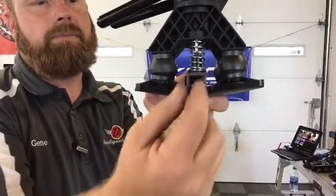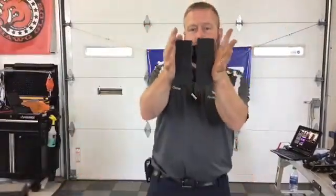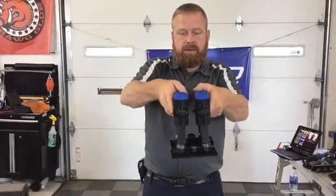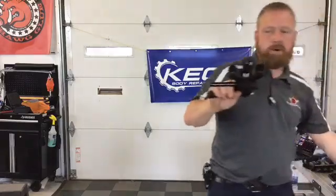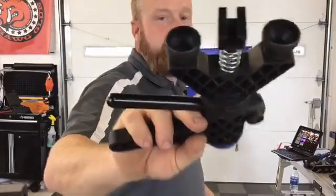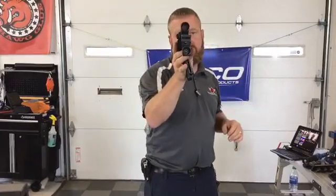The wide side on both sides gives you just enough room to get our 7mm crease killer tab in there. This locks all of that metal down, and because it's on the Robo system, it pulls straight up. We are actually able to pull body lines into flat metal with this setup. You'll also notice on here, same Robo body, the crease killer comes with a wide adapter. So it grabs about twice as much length on the crease tab as the standard pass-through head does.